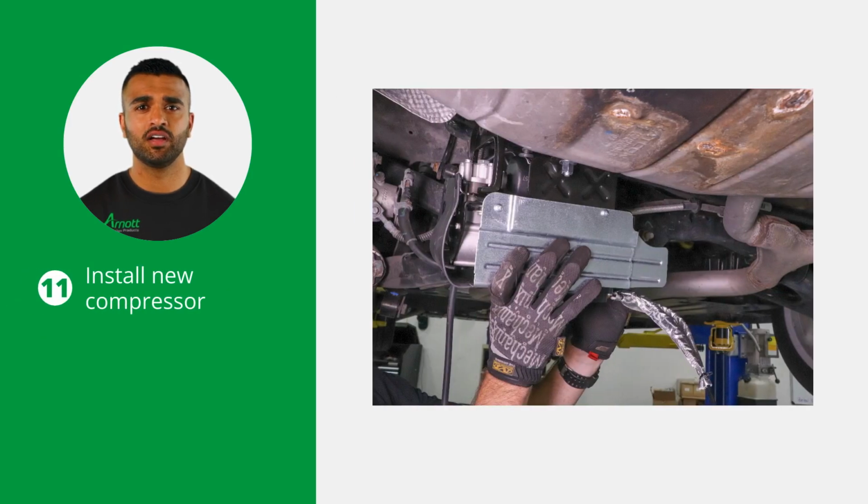Make sure to tighten all nuts and bolts to the manufacturer's specifications during the installation process. Do not remove the air fitting from the air suspension compressor. Doing so may cause damage or void the warranty. Remove the white shipping pin from the new air fitting and insert the air line until fully seated. Now, install the new compressor into the vehicle.